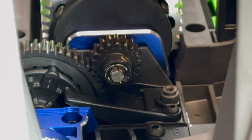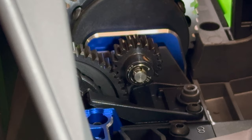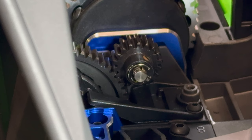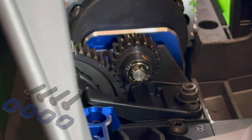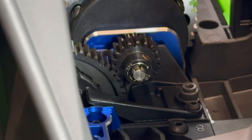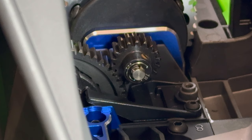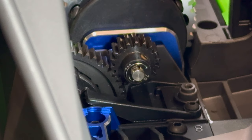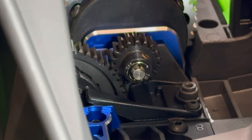That is going to cause your gears to chip and break — this is unacceptable. The way you fix this: if you have an X-Maxx running stock, remove the motor mount from the chassis, pull those pins out, put the screws back in, and mesh it by hand. This is where those little motor mount washers come in — those little washers you can get from Traxxas. An aluminum motor mount is a very good part to have, because that way you can put a little bit of Loctite on your screw, snug things up, and it's not going to move.